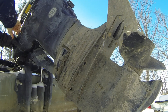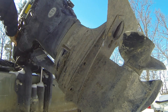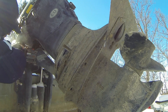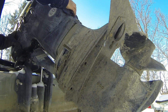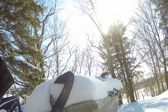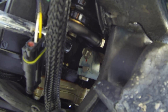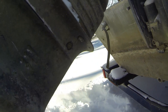We've also got our tilt controller here — we'll go ahead and unplug that connector so it all comes free. Now we can remove the cowling, trying not to drop any screws in the snow. With both sides of the cowling off, what we want to get at to release the shift rod is a little bolt right here where our socket is. That bolt holds the shift rod in place, so as we remove it, the shift rod will pass right down through, and we can take out our last bolt holding on the lower unit.